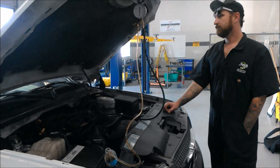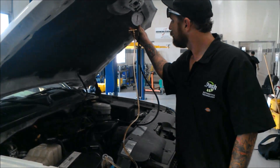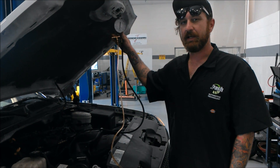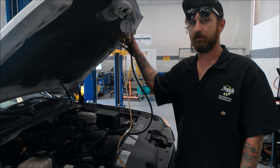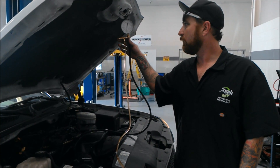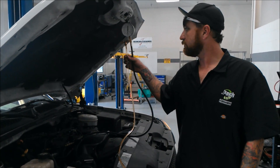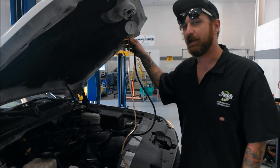Go ahead and start the car. We're at about 8 PSI now, which isn't enough pressure on the system. This car in particular is supposed to be at about 55 to 60 PSI, so we're already thinking that there's a problem with the pressure system. All I've seen is about 8 PSI.